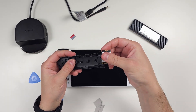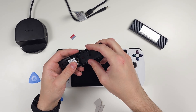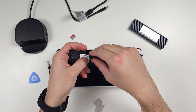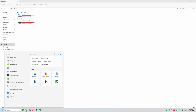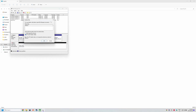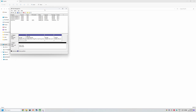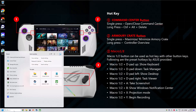Put your new SSD into the enclosure and connect it to the Ally. It's fairly straightforward — pop the drive into the slot and turn the holding screw to keep it tight. Mine also had some cooling pads that don't hurt to use. Open up Disk Management and make sure the drive shows up. You'll likely get a pop-up about initializing the disk — leave it as GPT and click OK. There it is — we're all set.